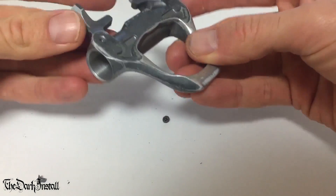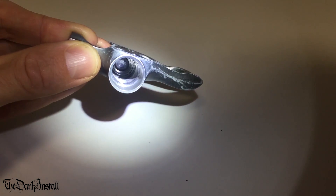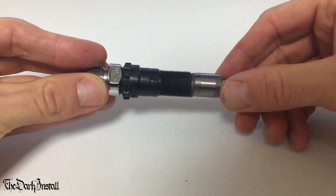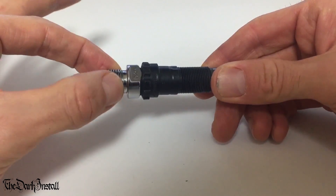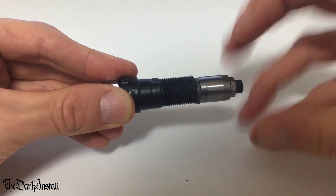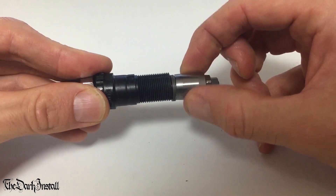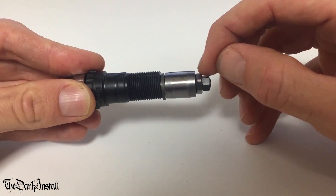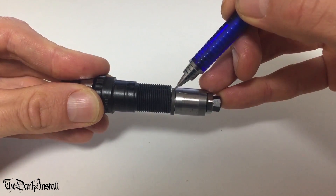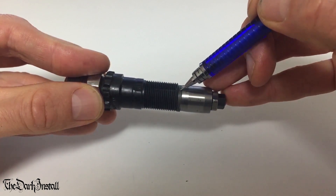Looking down into this, you can see that this is threaded inside. Next up is the axle assembly. This part screws into your crank. This part is a plastic or nylon composite part. This thread is the one that screws into the pedal body and holds it all in place. The ball bearing part - the turning part - is this little bit here. This here is the locking mechanism and allows for adjustment of the preload of the bearings. This little part here is non-functional and actually just allows for the axle assembly to be assembled properly. This just shows the level of detail and engineering that's gone into this thing.